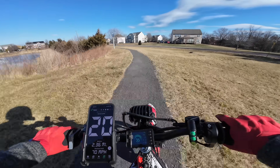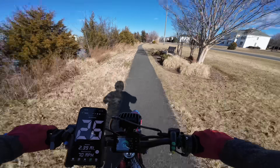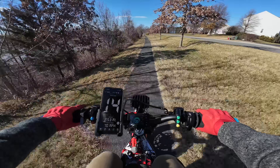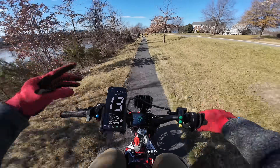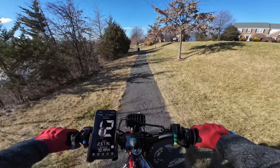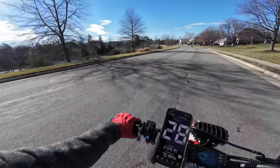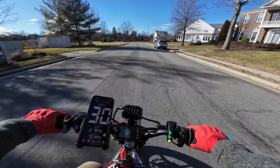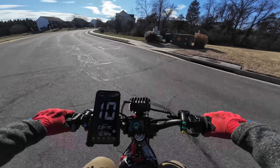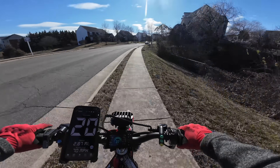This thing is so much fun. I can't wait till we have the new battery in to turn the power up even more so it doesn't have to cut off like that, because this thing was definitely tracking for much higher speeds. So as of right now, the only thing holding this bike back from going even faster is the battery output. This 20 amp hour battery is rated for 200 line amps continuous, which is simply not enough to supply all the power we're looking for to hit 80 miles per hour. I'm thinking I can even mess with the gearing — maybe step it down a little bit on the rear sprocket to a 53 tooth. I think just the rear sprocket change and the bigger 30 amp hour battery is going to force this thing over the 80 mile an hour mark easily.